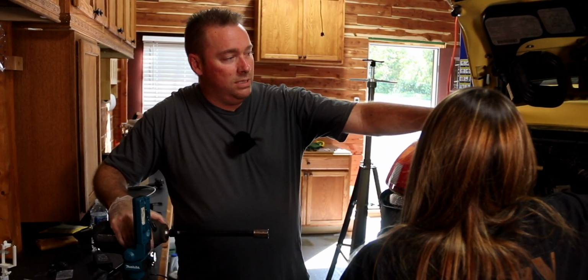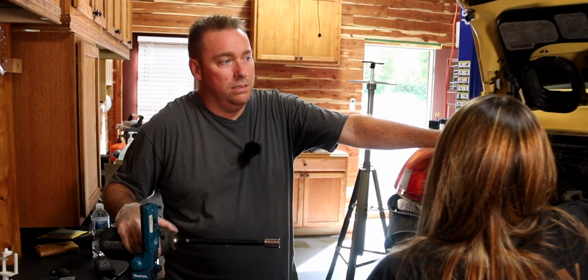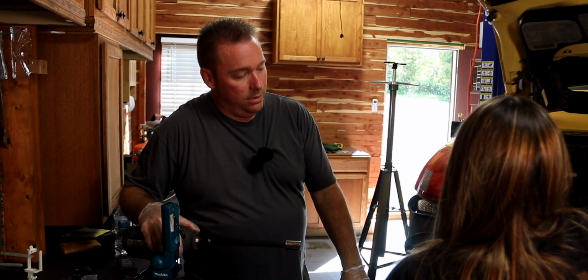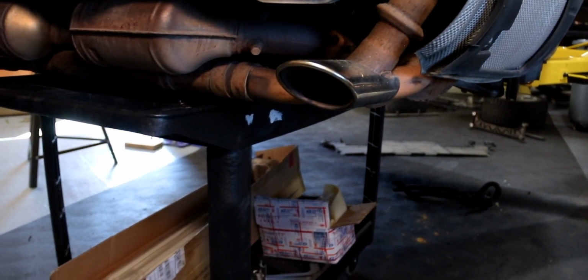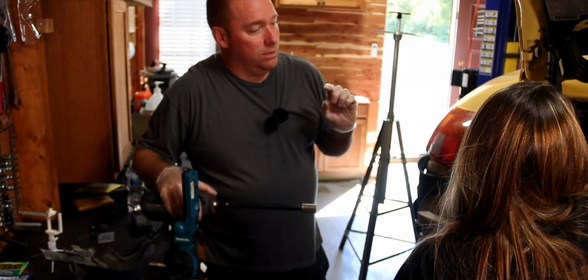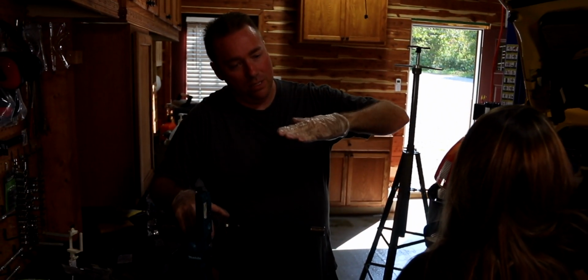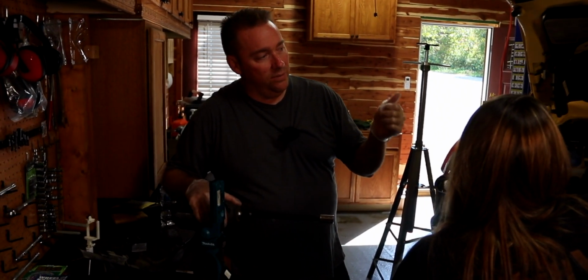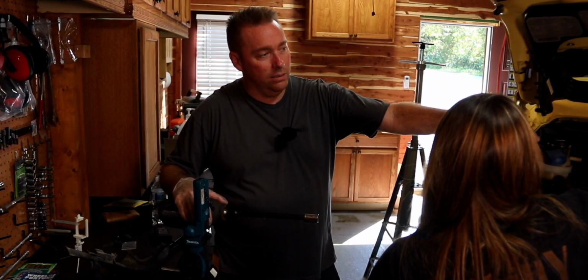We've got to take the coolant reservoir out, but you've got to let the engine down a little bit to get that out, just the way it is. So we have our cart that should hold 750 pounds, which is probably debatable at this point. But we're going to find out. What we're going to do now is take out the engine mount bolt on this side, and the other side is going to let the back of the engine set on the cart. We'll bump the lift up a little bit, and that is going to let the coolant reservoir come out.